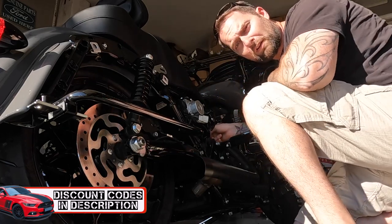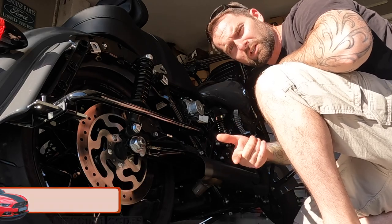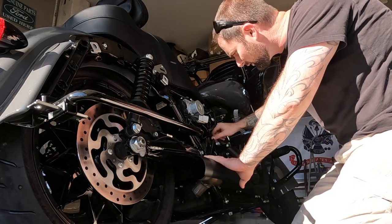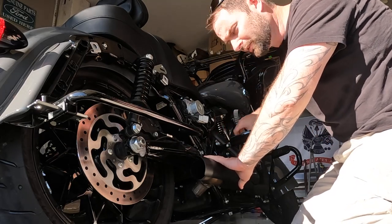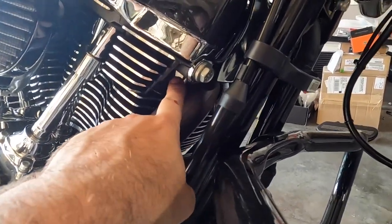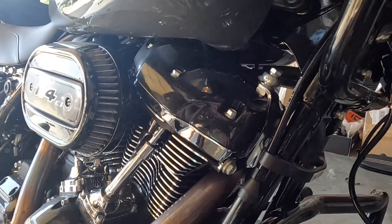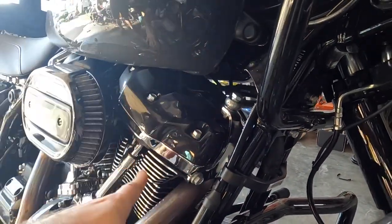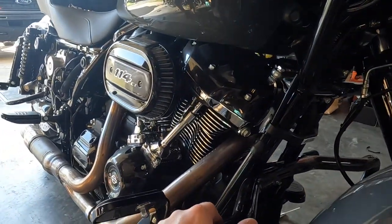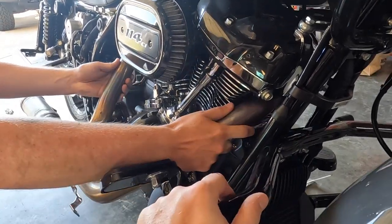The back head pipe is easy to get to, same with your O2 extension. But the heat shielding needs to come off - they're just worm clamps holding it on - so we can get access to the inside of the build next to the engine. I thought we were going to have to disassemble this whole silver piece, but nope, there's room to get to the bolts. The inside one's just a little bit of a chore but you don't have to disassemble it. This thing is ready to pull off.